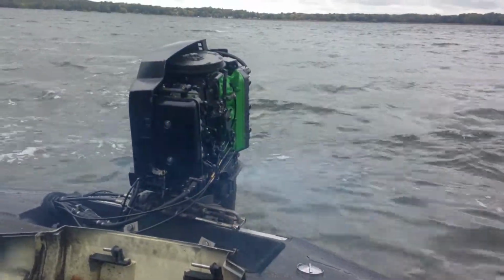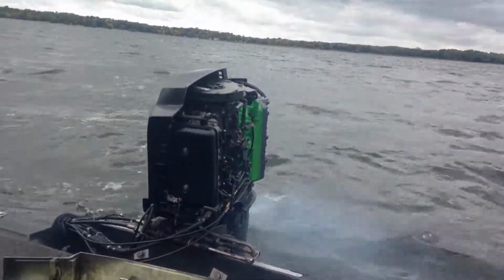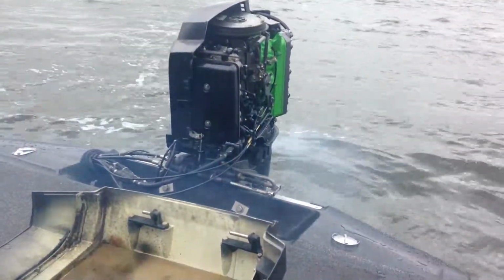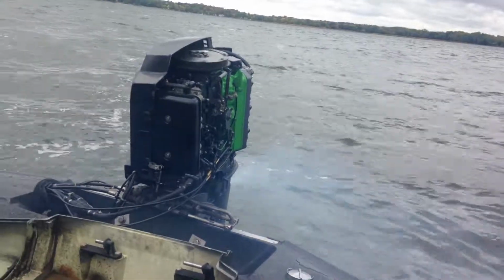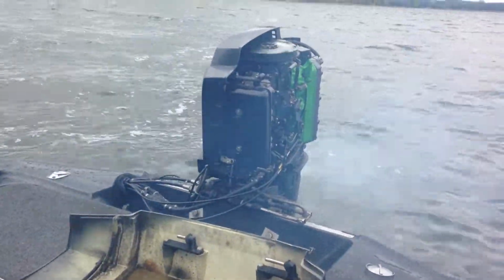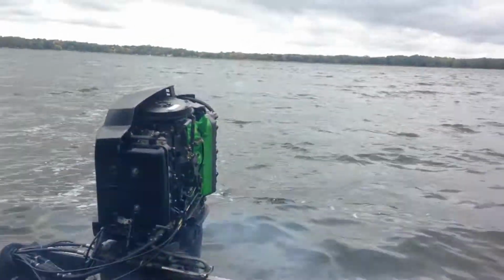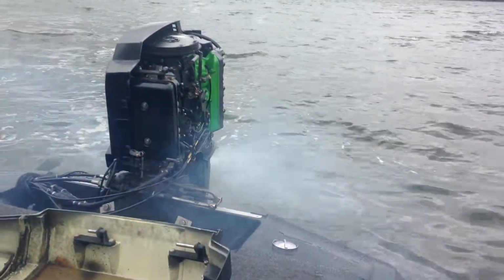Well, we're in the truck again. That didn't go so smoothly. Yeah, it didn't start right away. But we brought it back to the old farm, hooked her up, we got her running. So we're on round number 2. Get her done. We'll see how this goes. Alright. Well, it's running. We got to make some minor adjustments, but other than that, got the whole entire block together. She's a little bit smoky because we're mixing her real rich to break her in, but she shifts really nice. I just got the throttle too sticky, so I got to loosen the bolt on it, but so far so good. We're going to have to take her out and drive her around for like 5 hours.